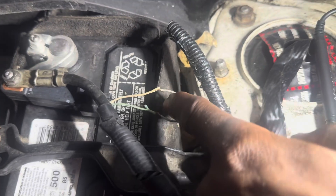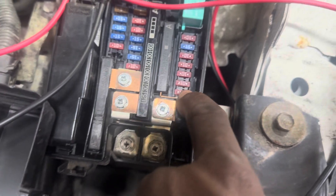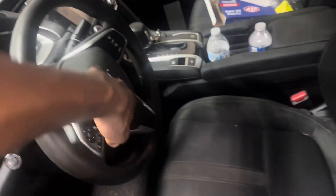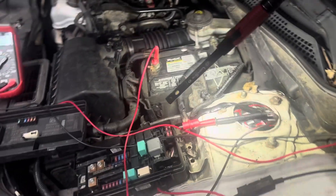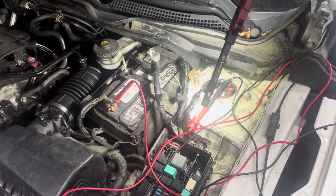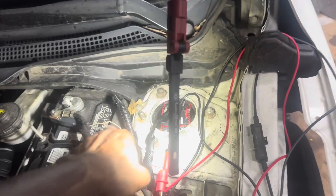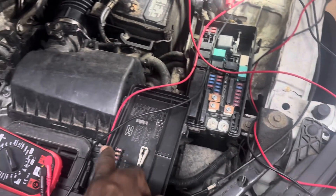It has two wires. The white wire has a voltage that is coming from fuse number 24. Fuse number 24 is the fuse for the horn. The first thing you need to do when you have a problem like this is go and test the horn. If you check the horn and it works, that means the fuse is okay. This white wire, this blue wire — it leaves here and comes to the engine computer.